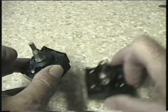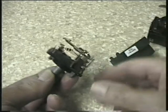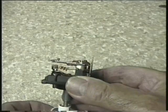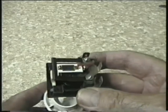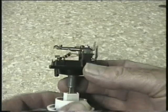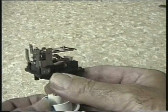Now we come to the regulators. As with the switches there are a number of different types of manufacturers. These are governed by the flow of electricity through a bimetallic strip rather than the temperature of the element, although it amounts to the same thing in the end. The hotter the element gets the more current it draws, and according to the setting you have the regulator at determines when the bimetallic strip will trip and turn the element off. In this way you can regulate the current and therefore the temperature of the element.